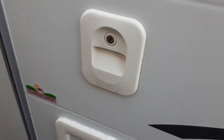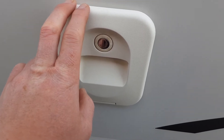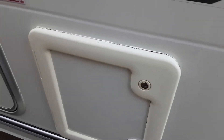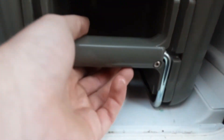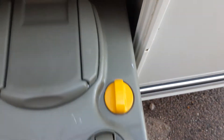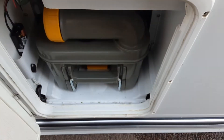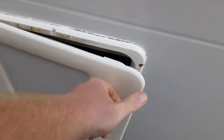Coming down the door side you've got the toilet flush tank. Open it up with the key and put three and a half litres of water in here along with a capful of the pink fluid prior to use. Below that you've got your toilet waste cassette. Press the buttons to open it, then lift the yellow handle at the bottom to remove the cassette. The neck turns 90 degrees so you can tip the waste away. The yellow cap is a measure for your pink and blue fluid, and on the back there's a yellow pressure relief button so waste doesn't splash back at you. In the cassette you'll need one litre of water and a capful of blue fluid prior to use.